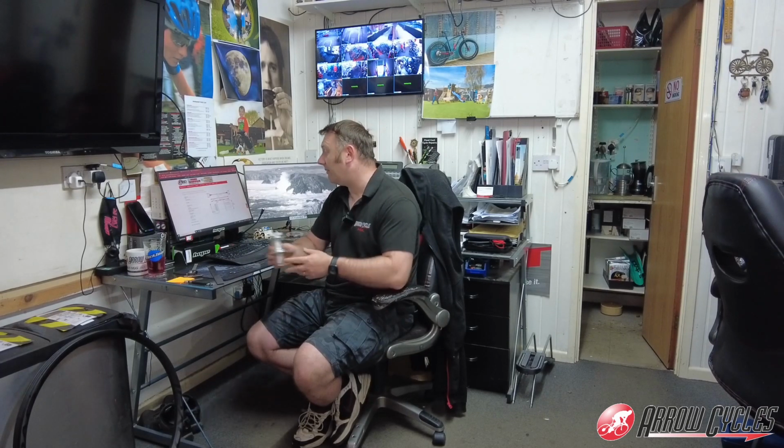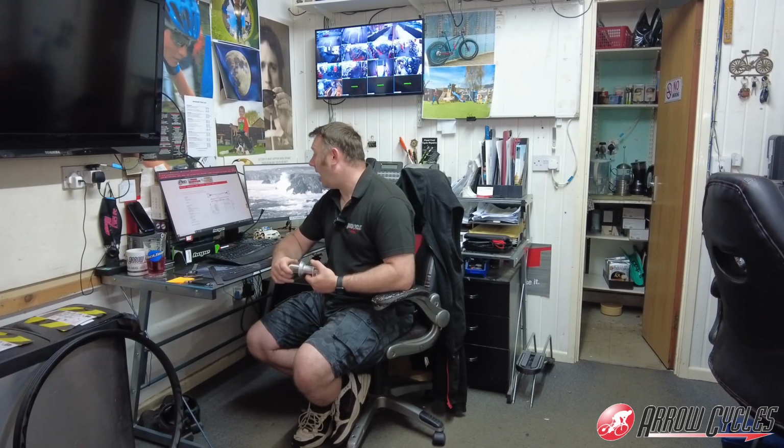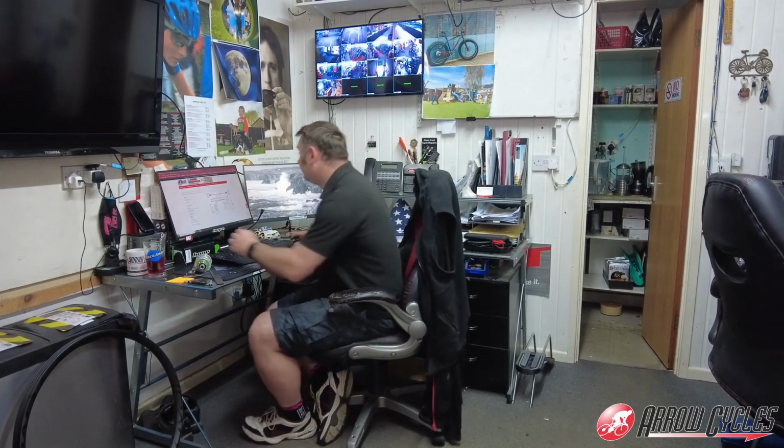But this has come out fairly even, so if we want to build the rim smack in the middle of the hub, it's going to need a 290 left hand right hand side, and we'll just quickly do the front wheel now and get that sorted. So now we have our spoke calculations all done and ready, and we need to start building the wheel. One thing I just want to quickly run through is how we're going to align the wheels. Now the rear one I'm going to build asymmetric, so this has been calculated to only make a 1% difference in strength, so it really isn't a big problem.